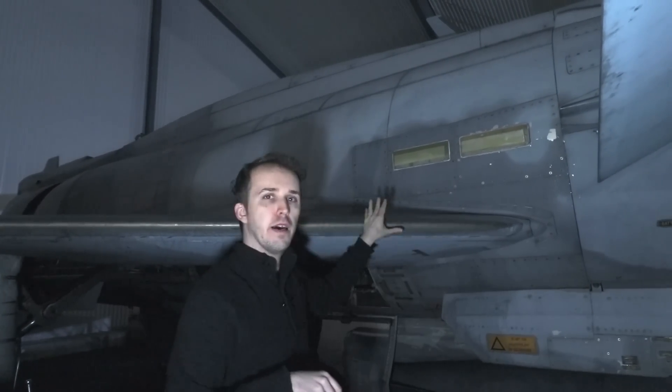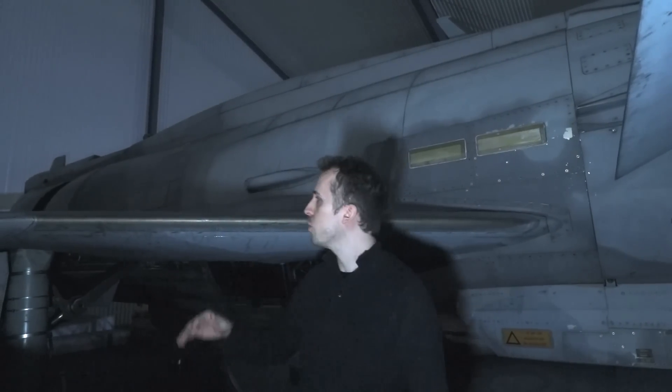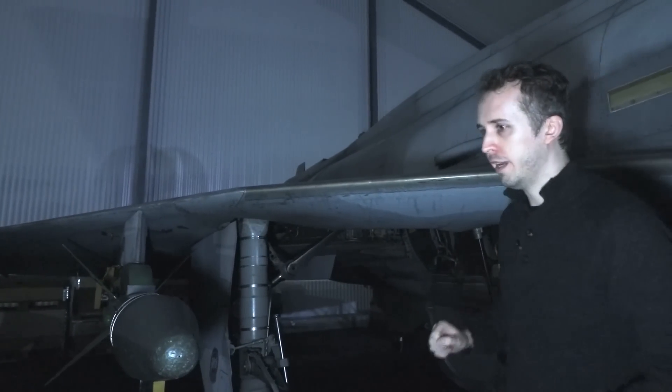Specifically, what we have in the Viggen are 12,000 pounds of fuel. The main tank is a saddle tank, sitting above the main engine situated on the centerline. You have two additional fuel tanks slightly forward, to either side of the aircraft just about where the canards sit, an additional fuel tank just behind the cockpit, and in the wing on the leading and trailing edge two additional wing tanks.